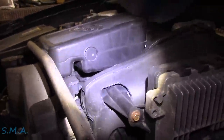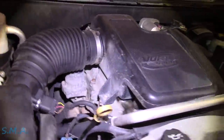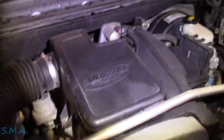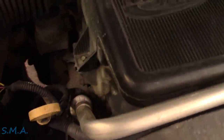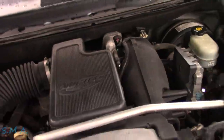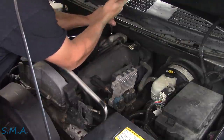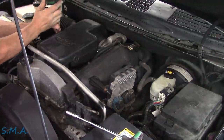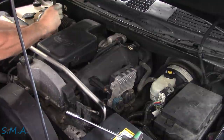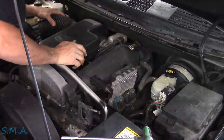We'll keep in mind that mice can chew through wires on a coil. I don't smell the mice - I have an abnormally large nose and I can usually smell them, but in this case I don't. I'm just curious - I know I said don't touch anything, but let's pop off this throttle body cover, it's only one bolt. Loosen up that clamp and take this 10mm off and have a look. I'm not sure what the other shop had done to it, but either way let's see what's going on - oh, there are two screws, sorry.